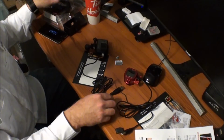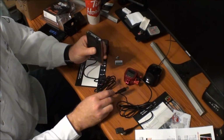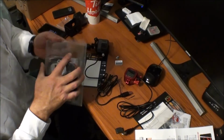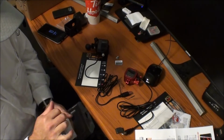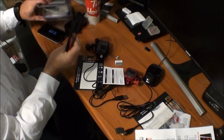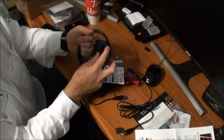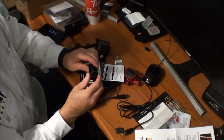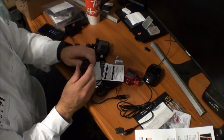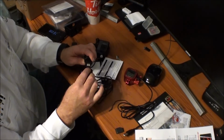So as I mentioned, you've got a couple of different options for power sources. You can use a power pack. Here's the 3BR PowerSports USB port. I'll go over that real quick. Power pack itself comes with a positive and a ground. It's fused already, so depending on where you're going to install it, you simply drill a hole. I think it's about a 1-inch hole, and slide it through. It's got the locking nut, put it in place, and your USB simply plugs in.